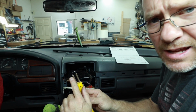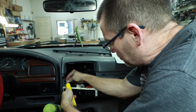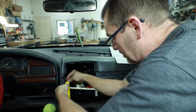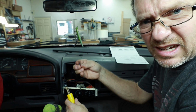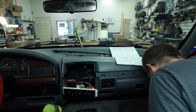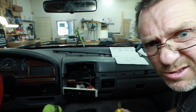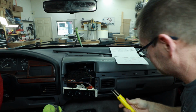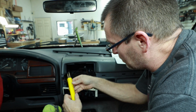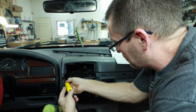There's different size staples depending on what it is you're actually trying to fix. So in this case, we're doing really thin plastic and making a really thin staple. And we got one little tiny piece left that we want to try to get in here. And unfortunately, it fell and disappeared. But we can still join the upper and lower halves together with a staple, which is really all we need to do to hold this thing in place.